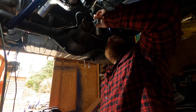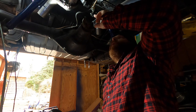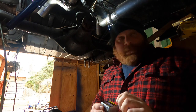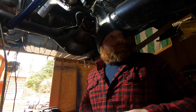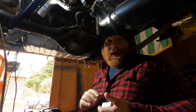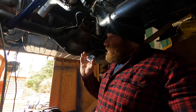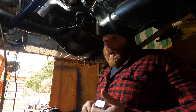The tail shaft and the angle of the rear end - you want to have them roughly within half a degree of each other. So if you had 5.5 there, you'd want about 5 here. This is not at ride height right now, so that number will change a little, it'll probably get worse. But we're putting in a four-link, so I'll be able to dial in that angle to exactly what I want.